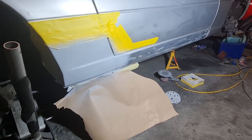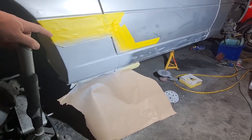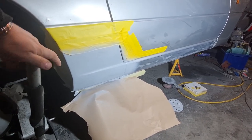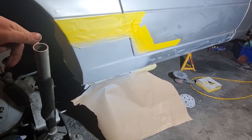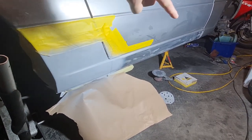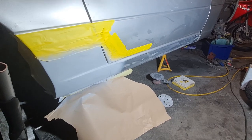Okay, as you would have seen from that bit of time lapse there, I've now got the rear section in primer as well, and I've just given that a little flat back just to obviously get it as smooth as possible. It probably won't make much difference because we're putting stone chip over it anyway, but I'm now going to get all this masked up all the way along, and then we can get it stone chipped all the way along,